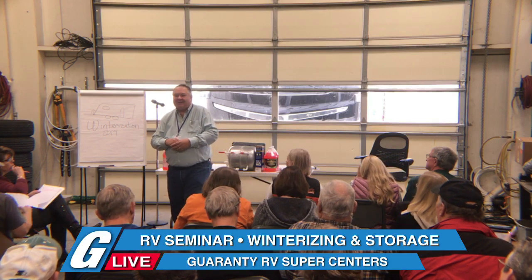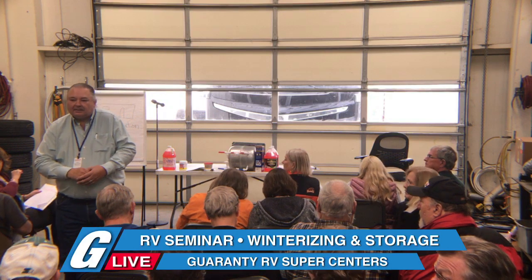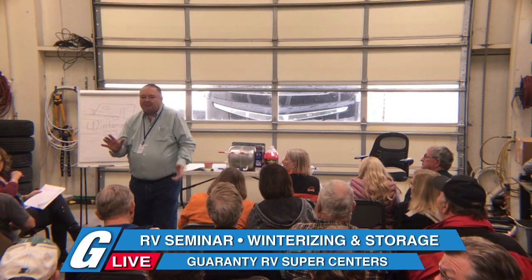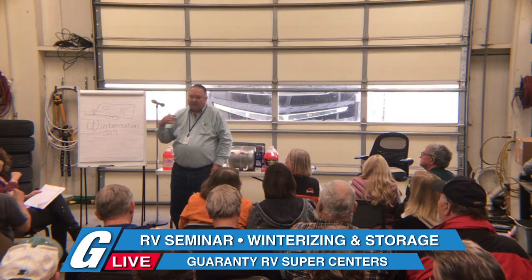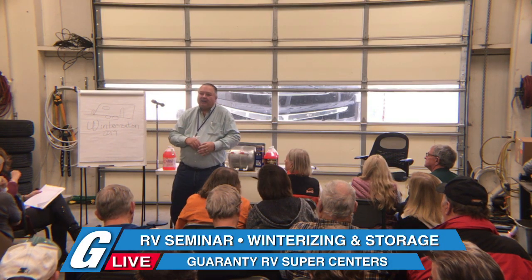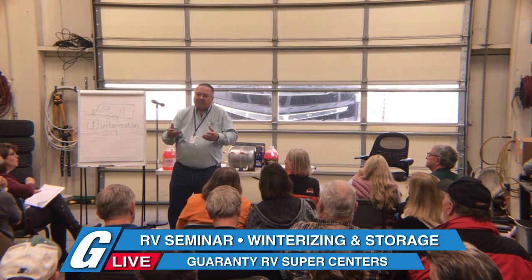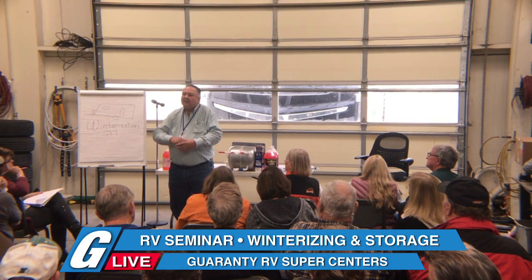So it's not good. So not heaters, but what about the furnace that is in the trailer? Why not keep that at 58 degrees? Not a problem. Now you can use, yes, your furnace. You're going to buy a lot of propane. But if you only do it during the times when it's going to be really cold, not a problem. Buy a little propane. Make sure that you're plugged in so that you've got your batteries charged so that the furnace doesn't pull the batteries down.